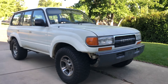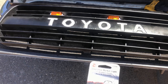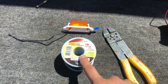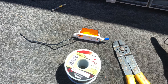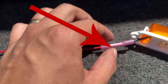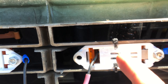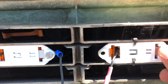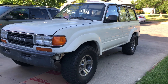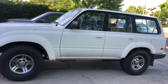I'm going to go over everything you'll need for this DIY installation. You're going to need three or four amber lights — I originally chose three but decided on four in the end, it just looked a lot better. You'll need 18-gauge wire, red and black, available at any hardware store (I got mine at Napa). You'll need wire cutter tools, watertight wire heat-shrink connectors (I got a pack of 10 at Harbor Freight for about three bucks), and some zip ties. I'll link everything in the description below so you can find it on Amazon or at your local hardware store.